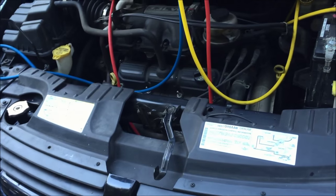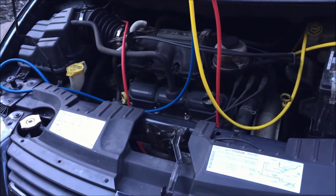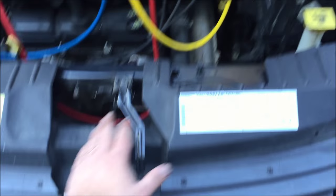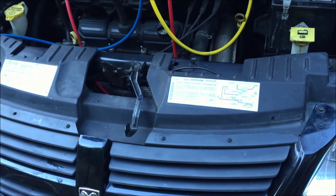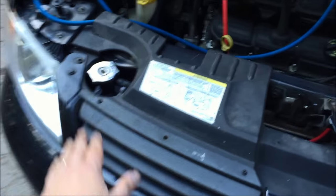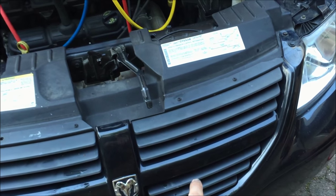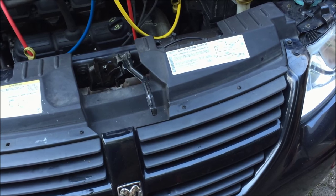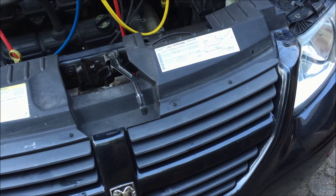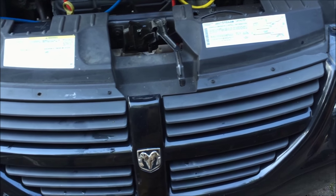Job's all done. I got the radiator back in — that went in very, very easily. What I would recommend: take some photos before and after and just keep track of all the little bits and pieces — there'll be bolts, there'll be screws. One thing I messed up was there's a rubber flap underneath that separated the AC condenser from the radiator — I neglected to put that on, so I had to work backwards a little bit. Other than that, it was just easy as heck. I filled up the radiator, ran it, got the air out. One issue: I liked the stopcock valve on my old radiator, so I put it into the new one and it didn't hold a seal. So I had to flush my whole system, replace the stopcock valve, and then fill the coolant back up. But otherwise it worked great. Good luck.